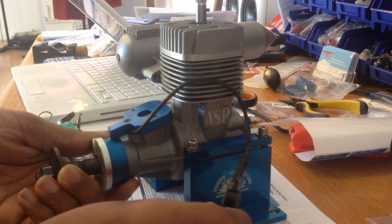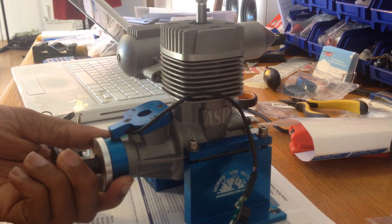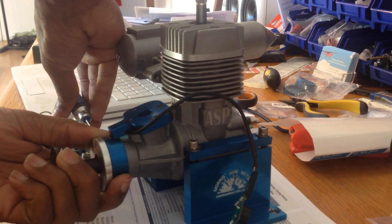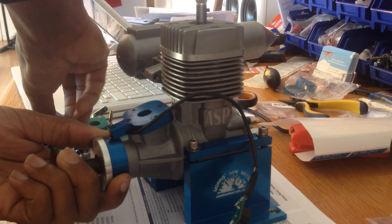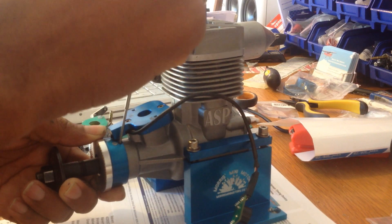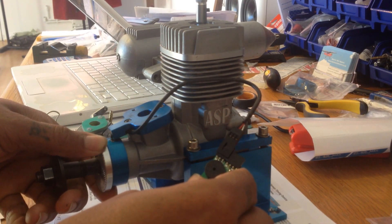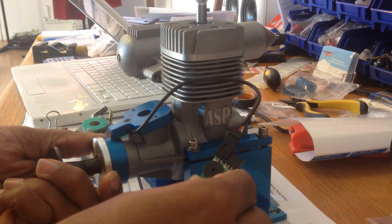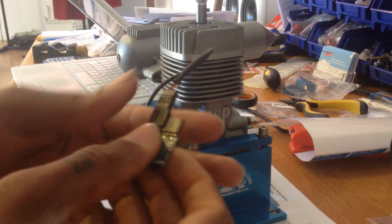So all I need now is just a wrench to tighten that. I'm happy with that. Tighten up the other screw. So as you can see, that's your timing already set. The prop is spinning anti-clockwise — going, going, fires. That's what I wanted. Just done. Unplug the sensor.